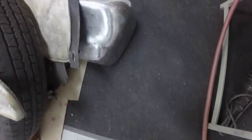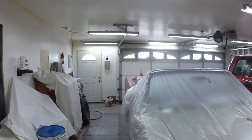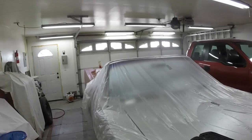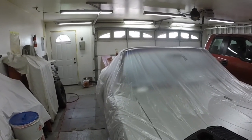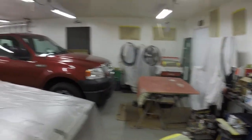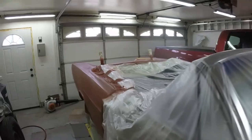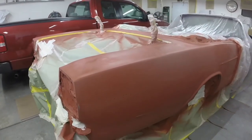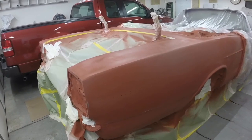Flower stuff is even blowing all the way up to this end of the garage from the wind. I had that door open for about 10 minutes just to air out after I wiped it down with solvent, and the debris that blew through here was nuts. I blew the garage out really good, closed the doors, then wiped everything down. I'll tack it before I spray it, but I'm just going to avoid the garage so I don't get anything on the panels before I paint them. I'm just going to close the doors up and lock the garage. I need to go wash my hands after handling those boxes. I'll take them in the house so they don't get damaged until I need them.